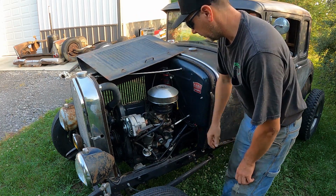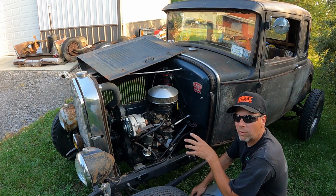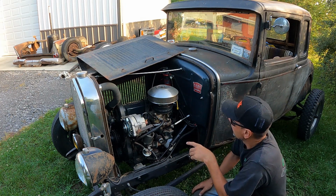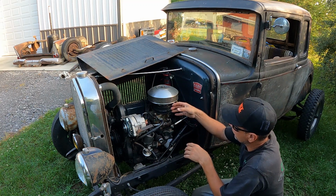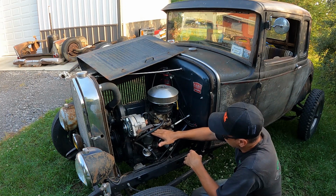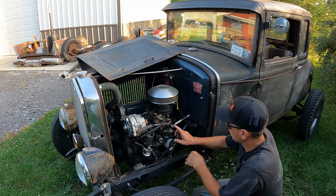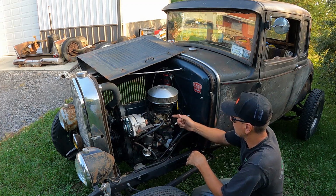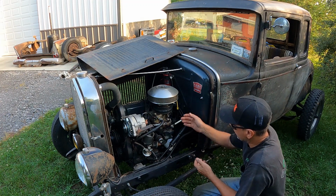the engine and transmission, this is a 1988 Ford 2.3 liter 4-cylinder Mustang engine. It's got a Holley 2-barrel carburetor on it. This was a fuel injection engine. I removed the fuel injection setup. I put the electronic Motorcraft Dura Spark 2 ignition in it. I put a manual fuel pump on it, and I put a '79 intake manifold on it to run the Holley 2-barrel carburetor. It's all stock internally.